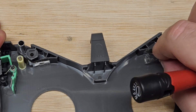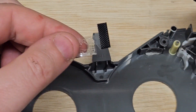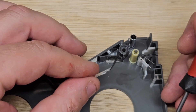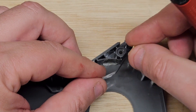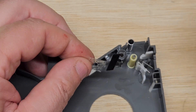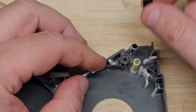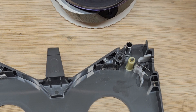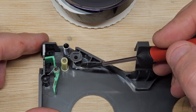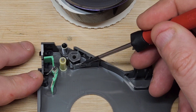You have to cut the tape at whatever length it's broken onto. These things basically push the tape up against this roller here — this little spindle roller. This glue is starting to degrade on a lot of these tapes. They fall off or come off and then attach to the tape, get clogged up in the tape, and damage it — and then you've lost everything on the supply reel. This side as well — as you can see, this one is virtually on its way out. This is a good example of what's going on. You can't just push them back — they will come back off again, so the glue is just dying.